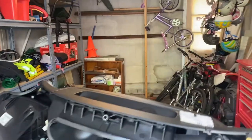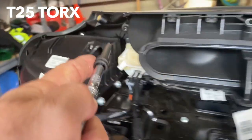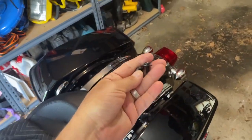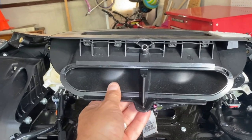Next step: one and two T25 bolts need to be taken out so we can take out this vent. Since this is the first time for me doing this, I'm going to mark each one of the bolts I take out - put them in a little bag or tape and write what part they came off. Just a little tape marked 'air vent.' They might all be the same bolt but I don't want to take chances. Now this vent just pulls right out gently.